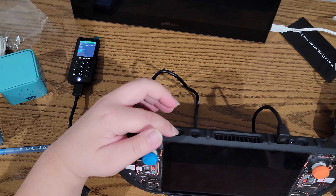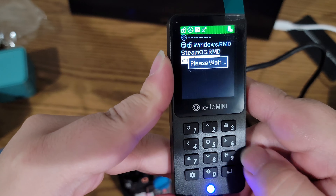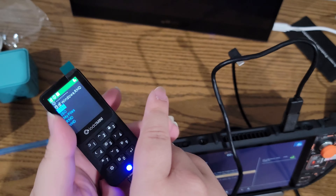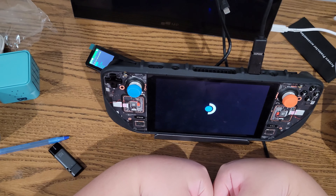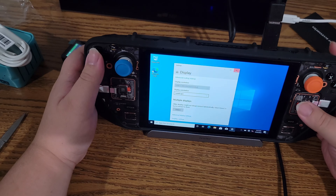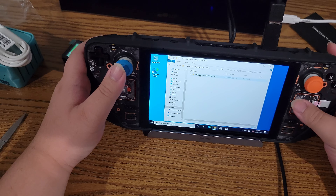You'll want to completely turn your Steam Deck off and then enter the BIOS menu by holding Volume Up and pressing the power button. You can plug the IODD in directly to the Steam Deck using a Type-C converter, or using a dock — a dock is recommended. Once connected, mount your Windows To Go virtual drive. It'll take a little bit to mount. Go over to Boot Manager and you should see a third drive — that should be your virtual drive. Select it, and as you can see, it's now loading Windows. Going through setup now, and there you go — Windows is working. All you have to do is adjust the display and everything works as it should. While booted off this virtual drive, the rest of the drive acts as a regular flash drive accessible within the operating system — useful for installing drivers downloaded beforehand.